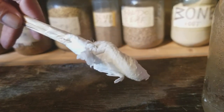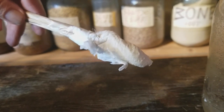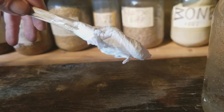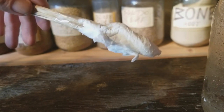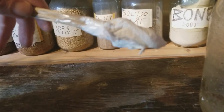Yeah, just for when I put the fuel system back together with the fuel pump, fuel filter, and the tank. Just try and get it as clean as possible, so that there's no more junk inside that can cause this to happen again. So anything you can do to prevent any of that. Because, you know, you get corrosion through condensation if your tank's just sitting.